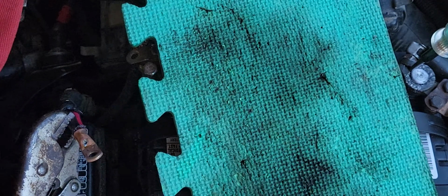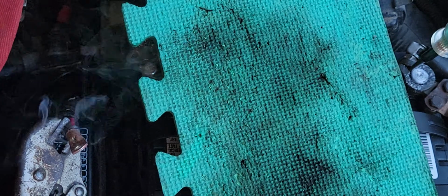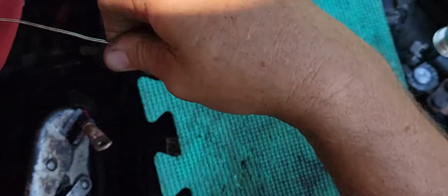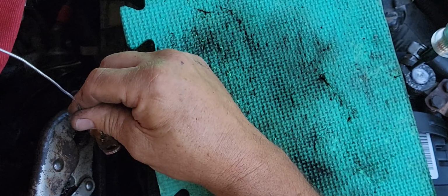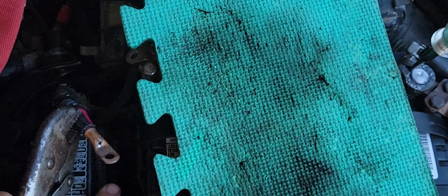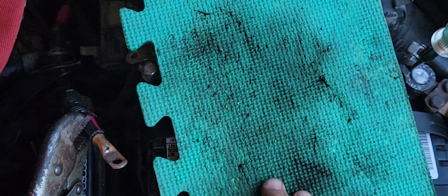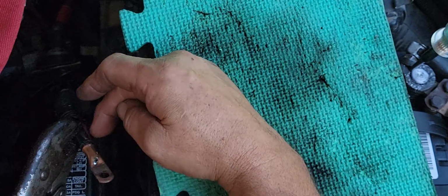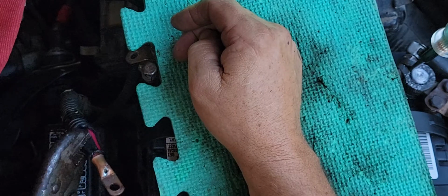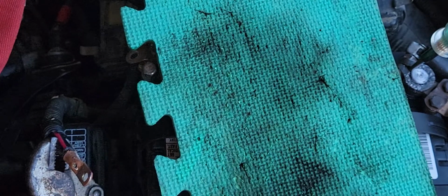Get a little bit more. But that's really all you need to do, is just be patient and get that thing soldered nicely. Once that solder cools, it'll be done. Yeah, we got a little bit coming out the bottom. Got a little bit of a drop coming out, so we'll shake that off and it'll be fine. Let it cool. We don't want too much solder, because if it starts wicking down in here, then it'll make this wire too rigid, and we don't want that. So we're looking good. Now just be careful with that, because it's still hot enough to melt the battery and everything else.